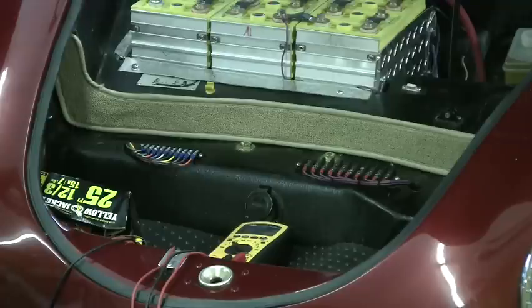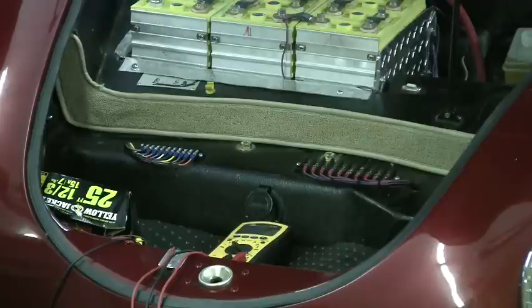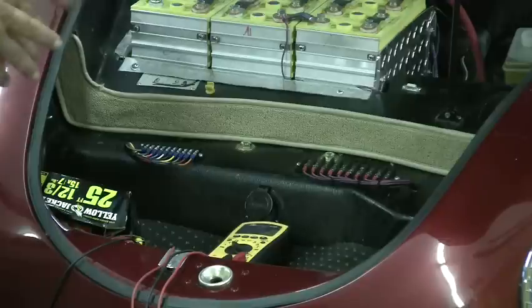If that's not working out very well, and I've got some test equipment, we can actually run the batteries all the way down, charge them back up, and see how they perform at various levels. But at that point, if I can't get it back in line, we replace the cell, try to get that married back into the battery, and then put the battery back in the car.